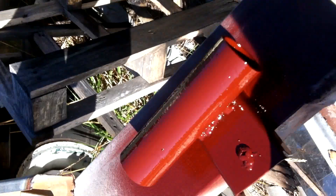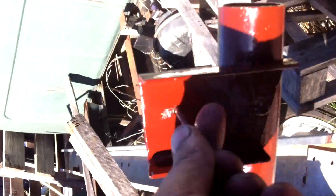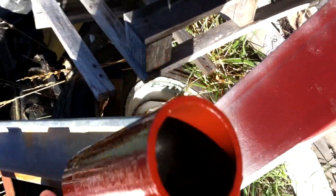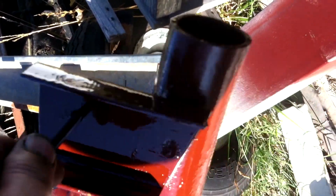G'day people, just a little custom thing I made up for my van here. It's just a bit of channel galvo and a bit of piping galvo — I've welded them together, then I've sprayed them up with Indian Red, just to make it blend in with the van easy. And I cut the channel to the same shape as the rear bull bar, so it sits in nicely.